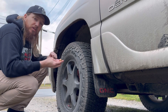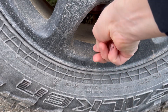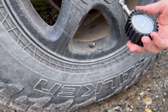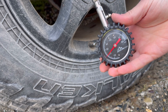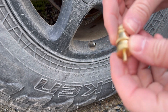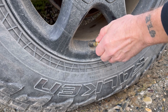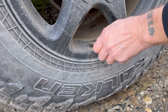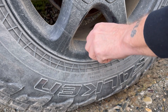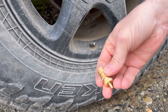To calibrate these tools, it's really simple and easy. You first have to get one tire down to the PSI that you want to run — in our case, 20 PSI. I got my tire down to about 21 PSI. By the time I calibrate all four, I'll be down to roughly 20 PSI. You want to make sure that the valve is completely closed. Screw them onto your tire, and then with the main part of it, slowly turn it out till you hear air. Once you hear air, turn it back in till it stops, locking it into place. Then repeat the process for the remaining three.